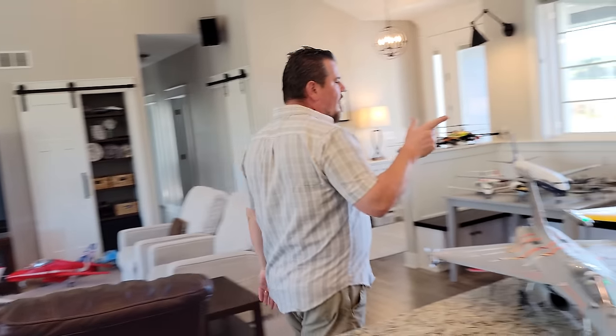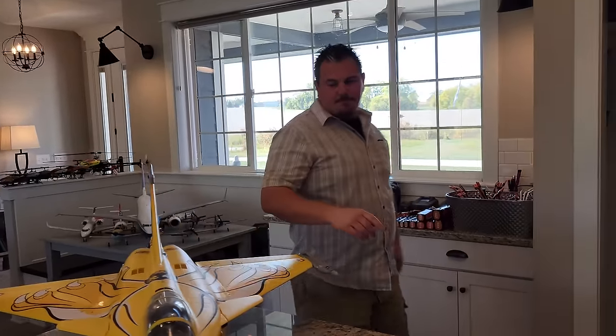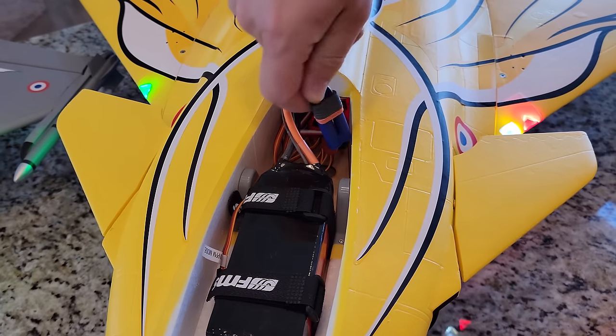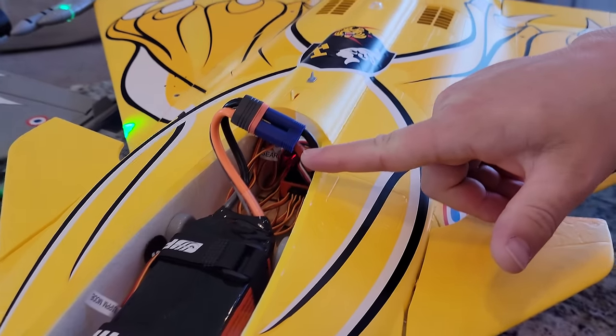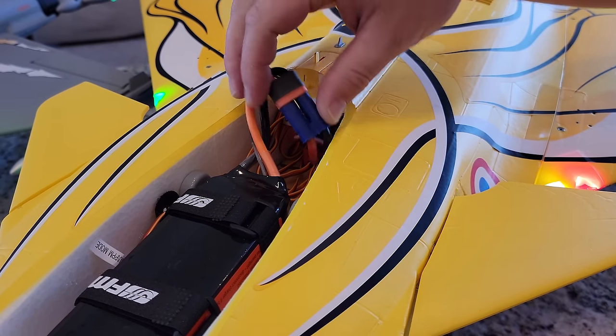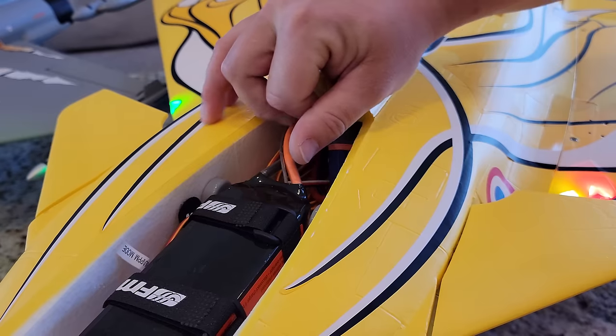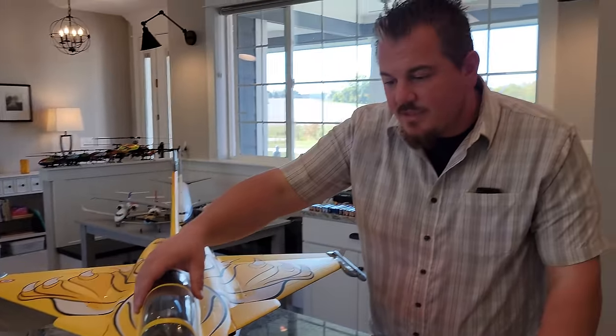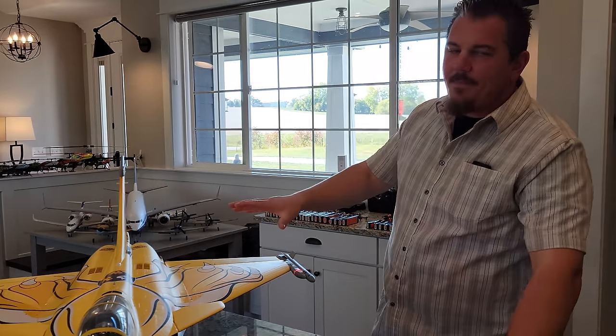And the 8020T is gonna give you one more thing you have to do, and that is that little red and black wire would have to be landed on your battery lead. And so wherever this comes out, you would just pierce the positive and negative in and then carry it back to where you put your receiver, okay? Now that receiver is also not spatially aware, and so you can put it wherever you want. And so that's one thing that's really nice about this Reflex setup, is that you see how much cable management I did, which was like none, and yet the battery's in there.